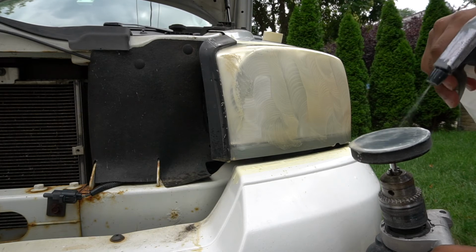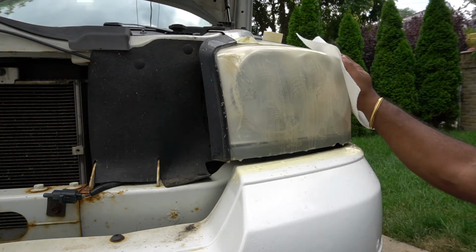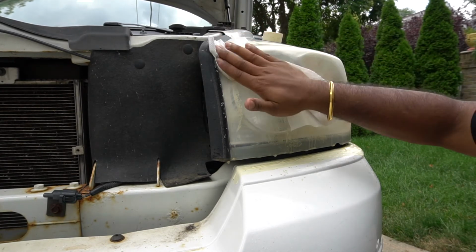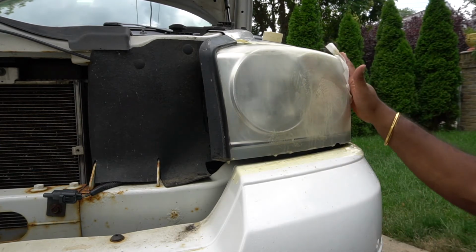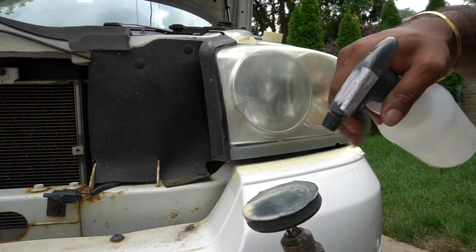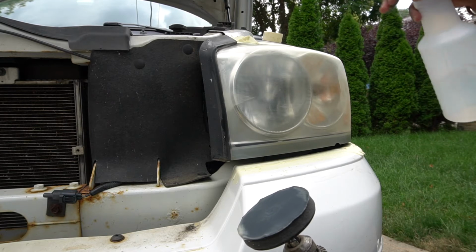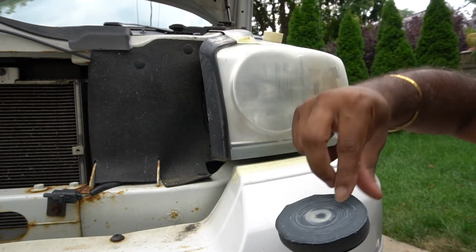And you could always periodically spray your pad as well. When we're on the 500 grit, we'll be doing a lot of the cutting with that pad. So you will see a lot of the yellow come off in this process. And let's see. This pad still looks okay. Let's go ahead and wet this again. Cool, so that was our first round with our 500.